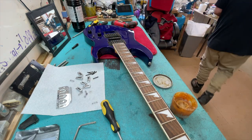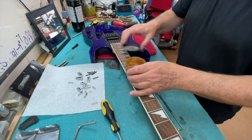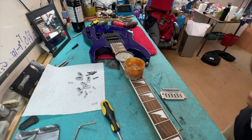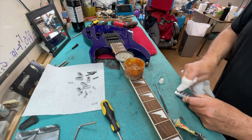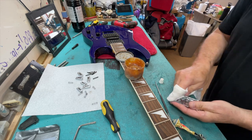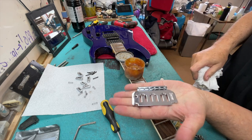Okay, let's take off these gloves for a minute because we've got a fair chunk of the goo out of the way, and I could do with access to my fingers. Now this could do with a little bit of a clean up. So I'll find my ancient tin of Autosol, and we'll use this grimy cloth here. And the Autosol is fantastic, a bit mucky to begin with, but a tiny amount of this really does go on chrome and shine it up very quickly. So we can get rid of that long stuck baked on tarnish very effectively using Autosol. And we can do the same for the saddles if they're too grimy. But you'll see very quickly that tarnish is pretty much gone, and we've got a nice clean plate.